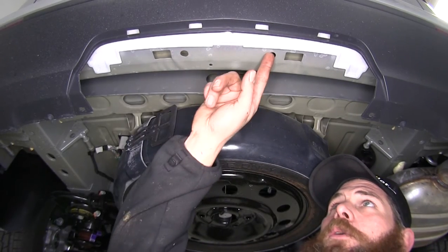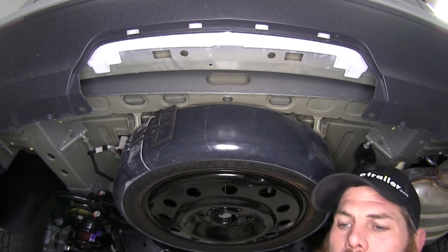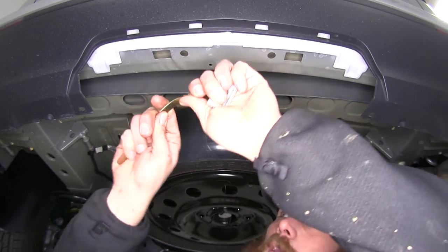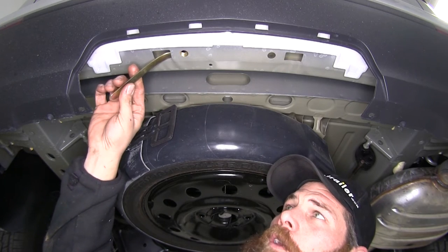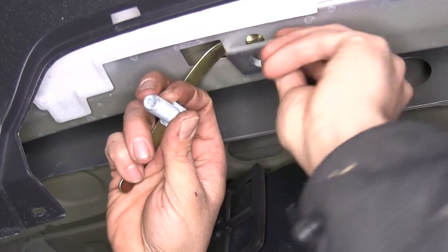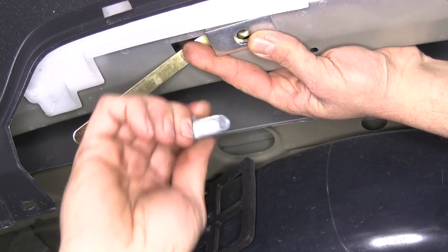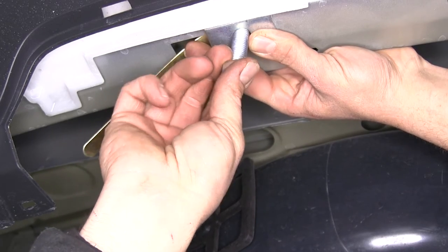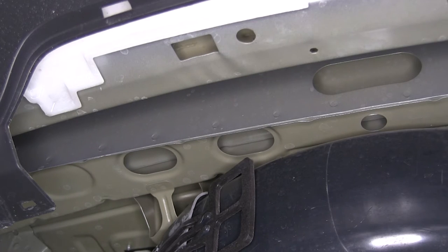For the middle connection point, we'll use two holes just inside the rectangular shaped opening. We're using what's called a handle nut — it can be bent to whatever shape you want. Slide it in, rotate it, and it sits right over our hole. We then place a spacer block on top, bring up the hitch, and thread a longer half-inch bolt with a conical tooth washer through the hitch and spacer into the handle nut. We'll do this at both center points for a total of six connection points.